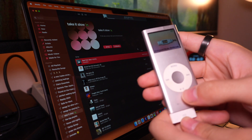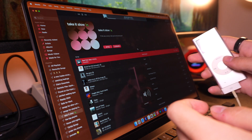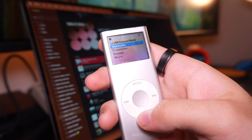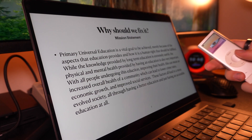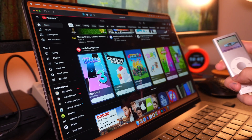For the last party trick, I present remotely controlling your PC or Mac over USB. By default, USB control mode is set to multimedia, which essentially lets you control whatever's playing on your PC as if it were an iPod — play/pause on the iPod plays/pauses on your computer, the touch wheel controls volume, and so on. If that's not your style, you can head to Settings, General Settings, System, then USB Keypad Mode to change it. For example, presentation mode works as a wired slideshow remote, or mouse mode lets you control your entire system using your iPod. You could even hypothetically click the subscribe button to get me closer to my goal of 10,000 subs — although you could do that without an iPod anyway.